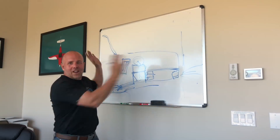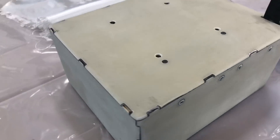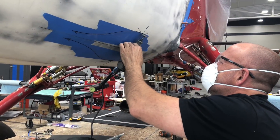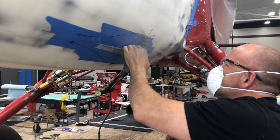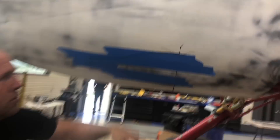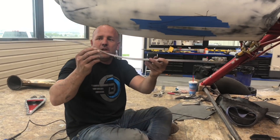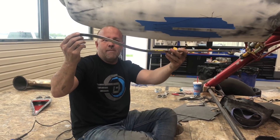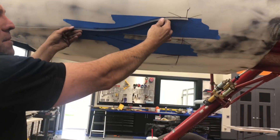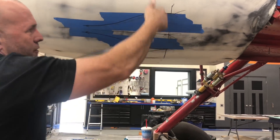So I know it's a mess - I'm going to try and build this. There's a battery this week, a few other things, some sanding and drudge work for paint. So let's get at it. Right here I've got to build a NACA - this will be the intake for my oil cooler. My oil cooler sits right up in here. I drew a template down on a table, bent this to match it, and now I can use this to get my correct NACA shape and transfer it onto the rounded surface.